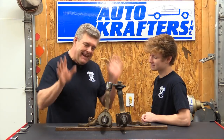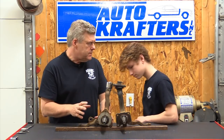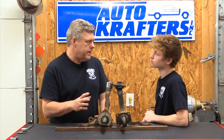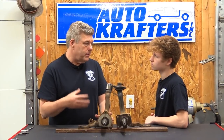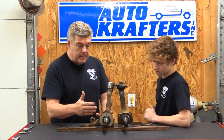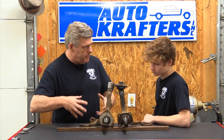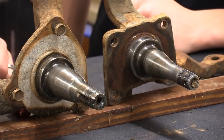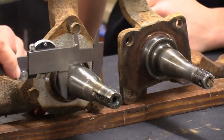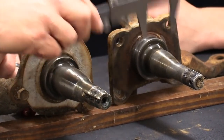These are different, and the reason they are different is that in 1969, Ford was doing a lot of Trans Am racing and they were having some problems with the spindles not performing up to snuff. So what they did is they went in and started beefing everything on their disc brake spindle up. Everything got a little bit bigger and beefier. In 1970, they went to a larger bearing set. If you put this on here and then come over here — big difference.